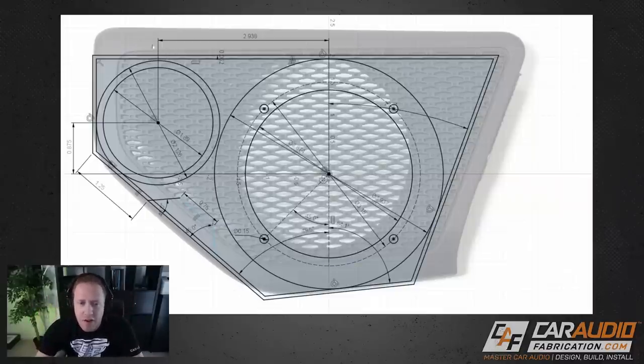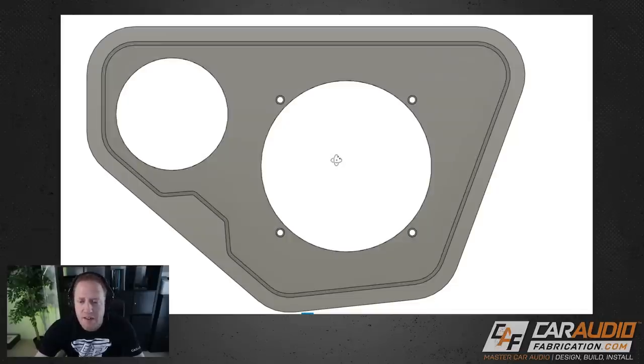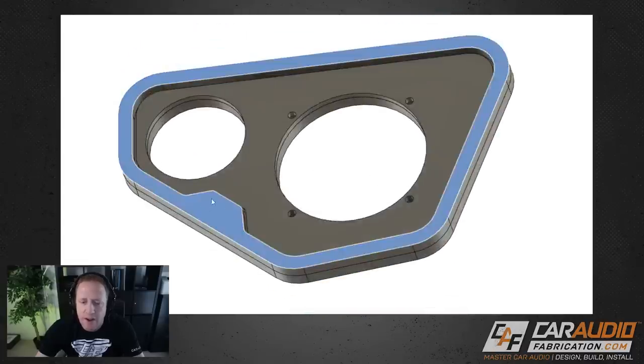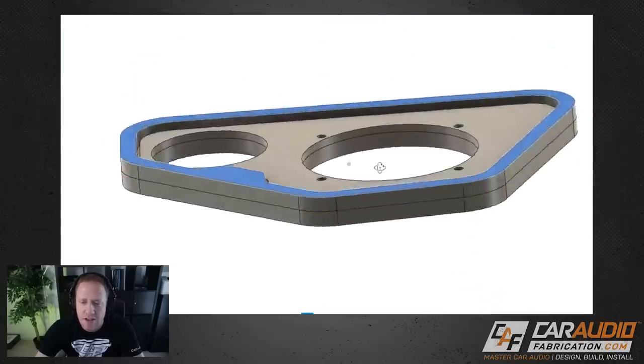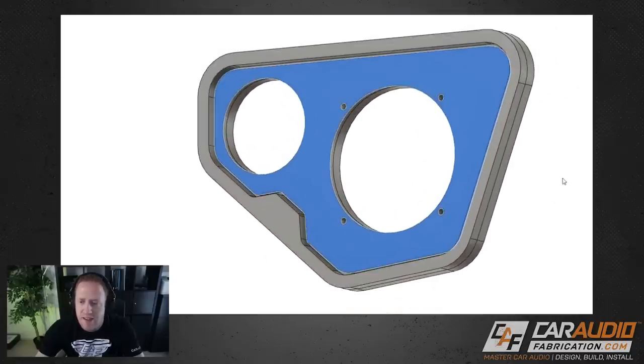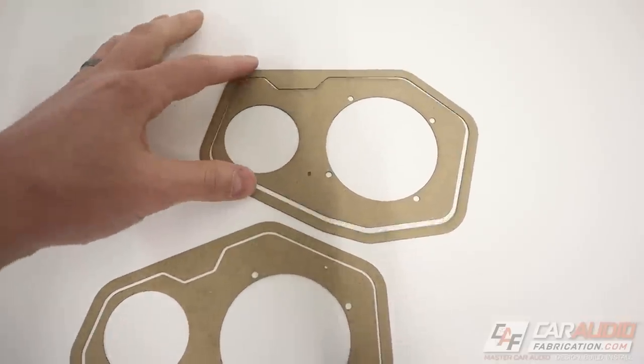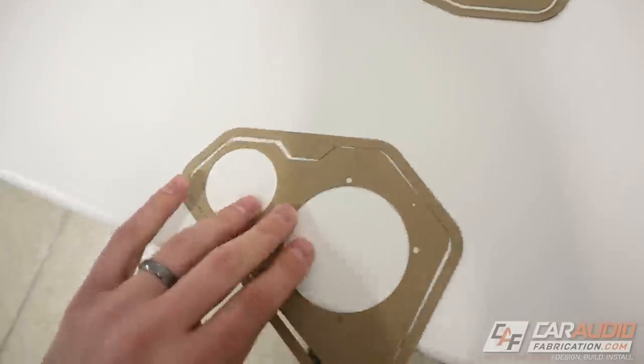We've come back to the drawing board. This time I took a picture of the grill — you can see it ghosted in the background — just to capture some of the existing geometry, match some of the existing angles, and get the general layout for what I think will fit. Otherwise, I did much like before: inner diameter of the speaker, outer diameter, bolt circle, and inner and outer diameter of the tweeter. I gave myself a nice expansion gap around the outside, went through the design process, and came up with this new shape. Much like before, we've got that quarter-inch base plate, quarter-inch trim ring around the outside, that little tab design to give it a unique look, and the same eighth-inch insert on the inside. I want to double-check this using chipboard again, so let's cut that on the laser. Here's a comparison — our original shape versus the new shape — let's take it to the vehicle.